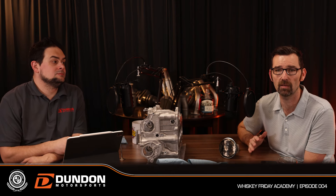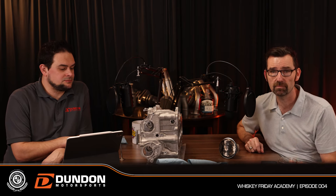The reason Porsche added that wasn't purely for power. You can fix the exhaust cam timing on a big lobe and make power at high RPM — that's what cup engines do; they have set cam timing. But you can get a nice fat torque curve by manipulating cam events based on resonance waves, intake waves, and exhaust waves. That's a 201-level topic.